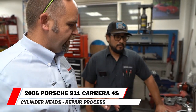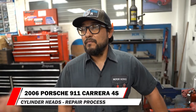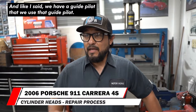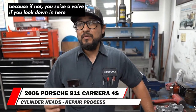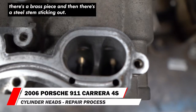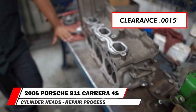They reused all the valves and springs, but the exhaust guides are replaced. The stem-to-guide fitment tolerance is a thou and a half — the guide is 0.0015" bigger than the stem of the valve. Each one is honed individually, one at a time, using a guide pilot set to the proper clearance to make sure there's no interference. You need that clearance — if not, you seize the valve. Looking down in the head, you can see the brass guide piece and the steel stem sticking out, with 0.0015" clearance between them.